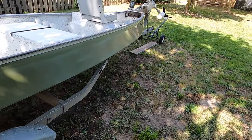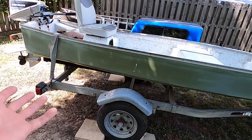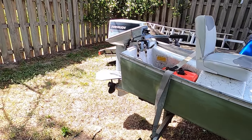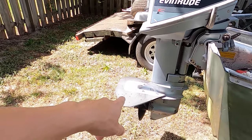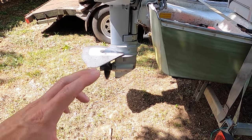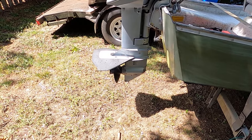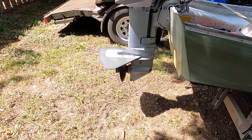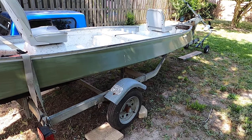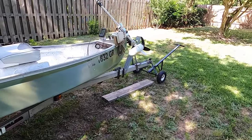It's a great setup — we've caught so many fish on this boat. Mom and dad used to live on the lake so it sat in the water and got a little more wear and tear. With this motor setup, I put a planer on there and changed the prop because the old prop's bushing stripped out. Instead of the factory 11-pitch, this is a 10-pitch. This setup with me and my gear in it runs 23 miles per hour based on phone GPS.